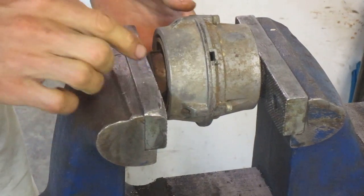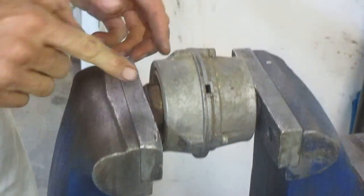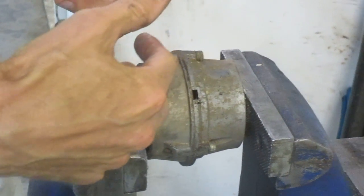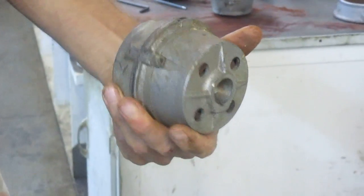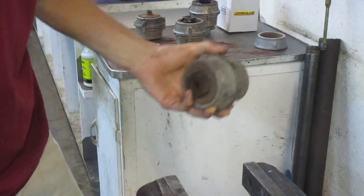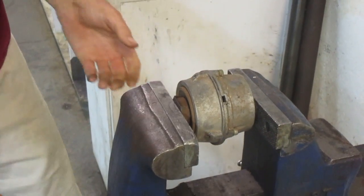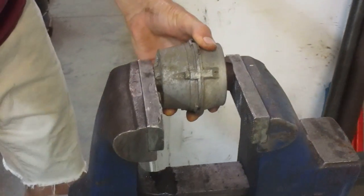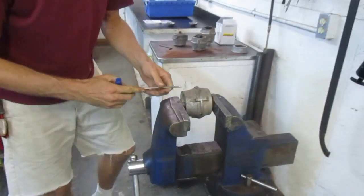When you squeeze the clutch lever, there's a fork that pushes this bearing in to push the inside cone down further inside the clutch. I'm pushing that inner cone in with the vise, which loads the spring but takes the tension off of this part. Normally the inner cone is pressed out against the outer cone with tremendous spring load pressure. If I were to start taking the bolts out without doing this, that bolt would snap in half and the clutch components would go flying everywhere with a lot of force. By doing it in a vise like this, I am controlling the expansion of that spring.